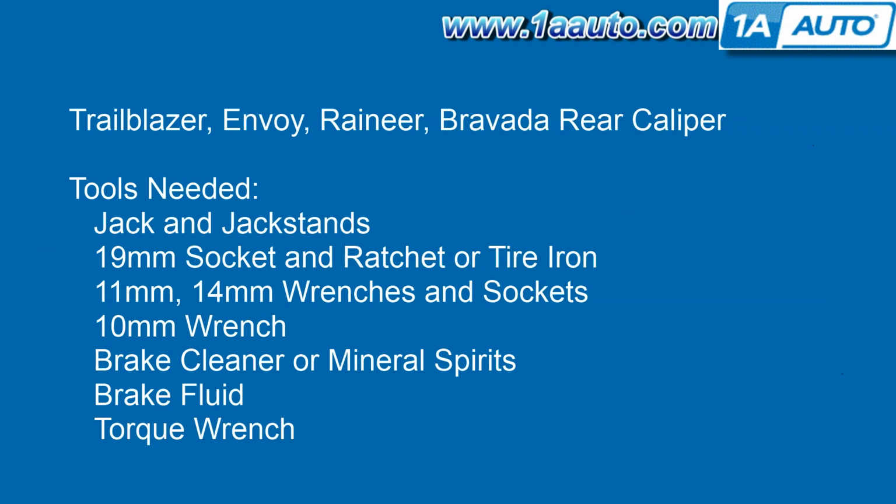Tools you'll need are jack and jack stands, a 19mm socket and ratchet or your tire iron, 11 and 14mm wrenches, and you'll need sockets as well, a 10mm wrench, brake cleaner or mineral spirits, some brake fluid, and also a torque wrench. And obviously we show you how to do one side, the opposite side is the same procedure.